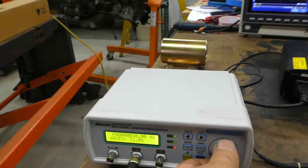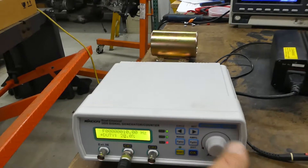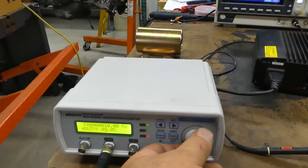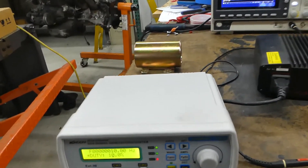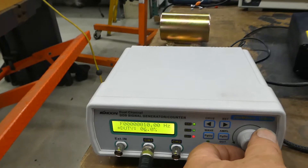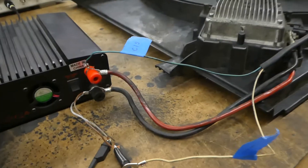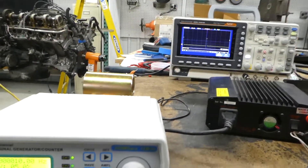Now we're going to bring it back down — back at 20% minimum speed. We'll bring it back to 10% to stop. Once you get below 10%, we'll see when it actually takes off. At 10% it stops, at 9% still stopped, at 6% still stopped, and at 5% it goes to full speed. That's going to blow the circuit breaker in here and turn off, and it'll keep cycling back and forth like that.